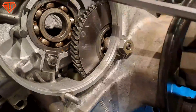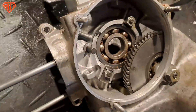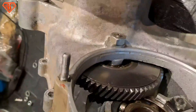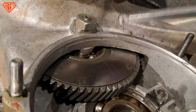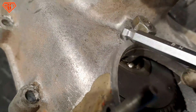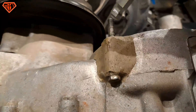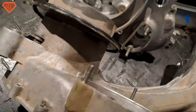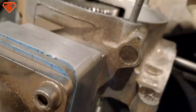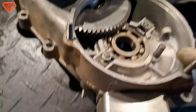That's an original 65 primary, and as you can see at the rivets on both sides, it was never renewed. The primary trick was not used — you tighten the screw when the clutch cover is on — and the security is missing. Someone destroyed the thread here and just put a long screw instead.